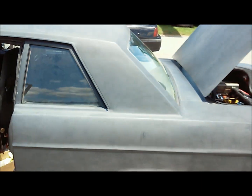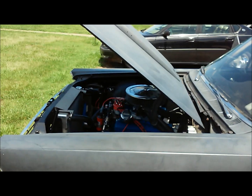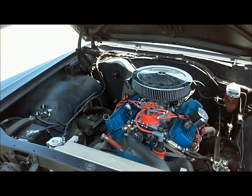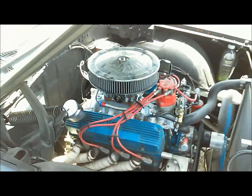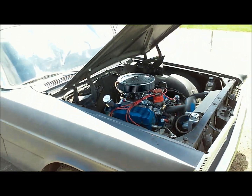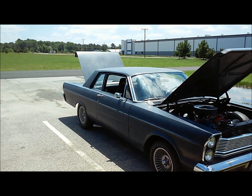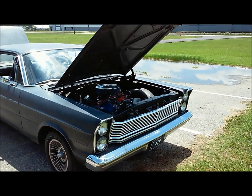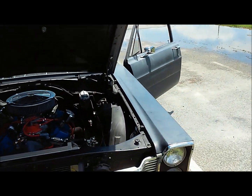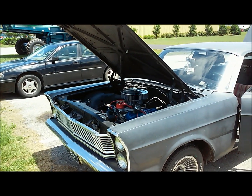You don't hear the pump now and it's bleeding off into the carburetor as well, so it's really not putting a lot of strain on that pump. There we are with our 289, holding a solid 7 pounds of pressure. Return lines — it's really saved me in traffic. I can just drive this car in any weather, any circumstances, and it holds up great. Fuel return line — it's the way to go with these classic rides.